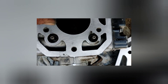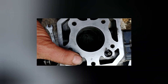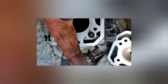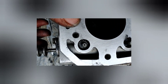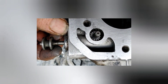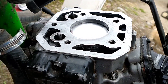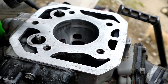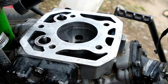When the power valve is fully open, the timing dot should face forward. Then when the power valve closes, it's like a door closing — they close that way. Everything seems tight now, it's moving nicely. I'm just going to make sure my valves are timed correctly, put those little bearings in and then the o-rings on top, and hopefully we should be ready to go.